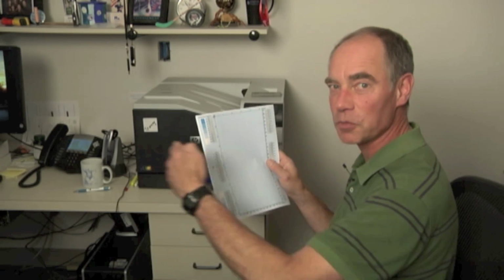What is that telling you? So full page, because the yellow cartridge went in the cyan slot, I've now got a mark in the page in yellow, and I can actually see it. What is that telling me? It's telling me that there's a problem with the slot, not with the toner cartridge. The machine has an issue, and I need to figure out what that is.